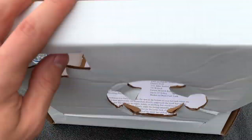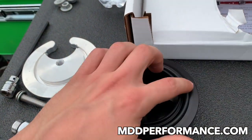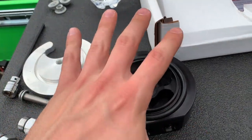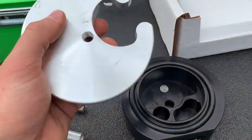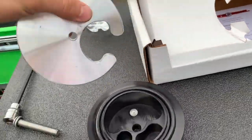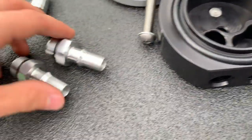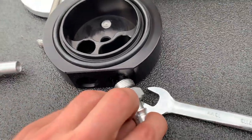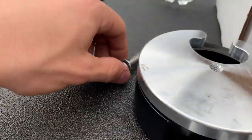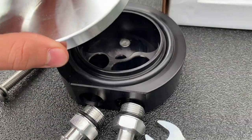These are Beans Diesel sumps — the ones I offer with the lift pumps on MDDPerformance.com. The main reason I really like these is because of the single o-ring. A lot of different brands have a bunch of little holes around here, but that creates that many spots for the thing to leak. This simple but smart design has a little cutout so you can get it into the tank and fish it up and in. The bottom bolt has a little o-ring, and these two fittings have o-rings as well — no need for Teflon tape. One fitting is feed, one is return, the tank clamps right in between, and the bolt from the bottom pulls the plate and sucks the o-ring tight against the tank.